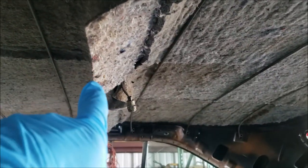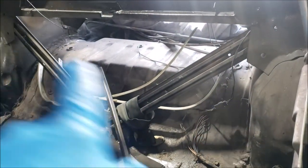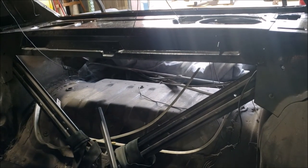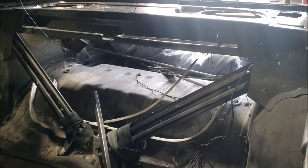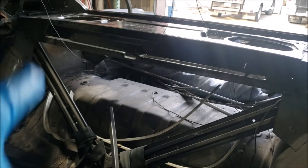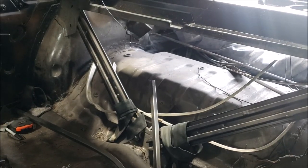I've got carpet sticking out in the middle with the extra cut away. Basically I have some carpet and jute pad for the ceiling — I spent 24 bucks total on all this carpet, 12 and 12. I'm going to use that to cover the hole and put sound deadener between the trunk area — it works really good especially since it has a rubberized backing, and the seat will go to the back of that. It'll go clear down to the floor and clear up to the package tray with sheet metal screws to hold that backing up, making good sound deadening.